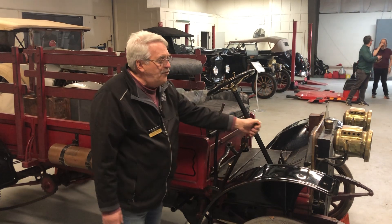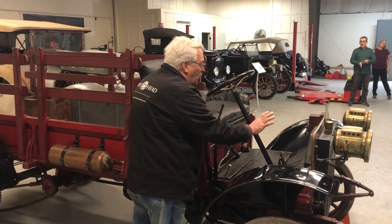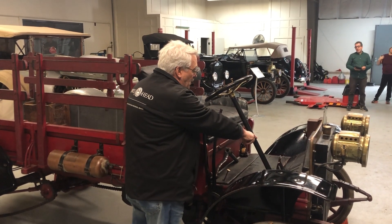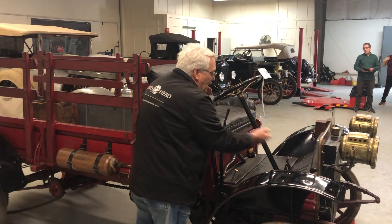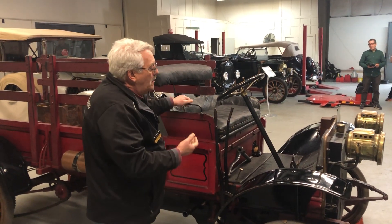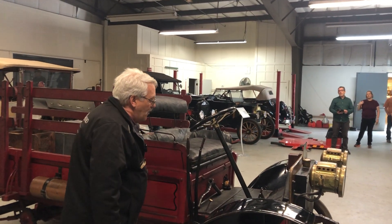This lever is your emergency brake — you better hope you never have an emergency. And this lever is high gear; that's all it does, it just goes into high. You start out in low gear on the pedal, and then when you've reached all of two or three miles an hour, you let go of the pedal and put this forward and you're in high gear. High gear is simply the engine and the rear end hooking up as one solid unit.